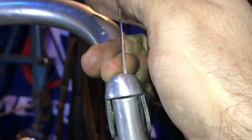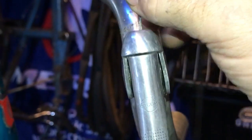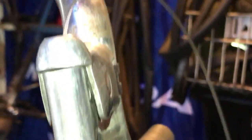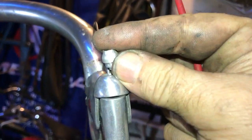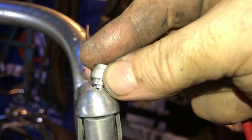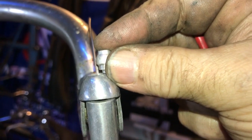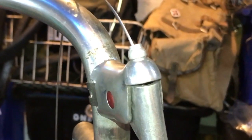I need to keep a little bit of tension on there while I pop a ferrule and the cable outer on, because I don't want it to drop out or misplace itself. It's a full length cable with a bit of weight dangling down — I think that'll hold it while I put the outer on. This is the ferrule variety that sits in the hole on top; I slide this over the end of the cable. I'll put on the aluminium one in this application, then do the same with the outer, giving it a lube before I put it on.